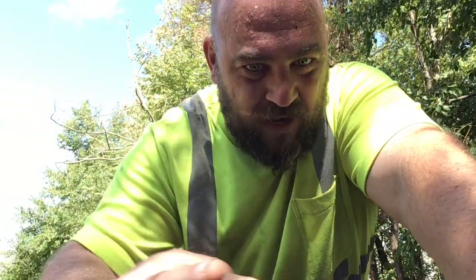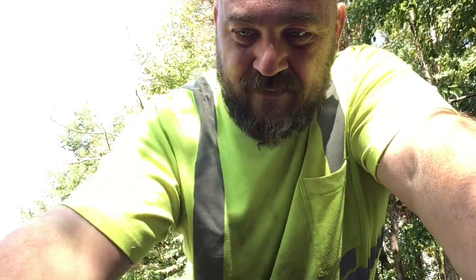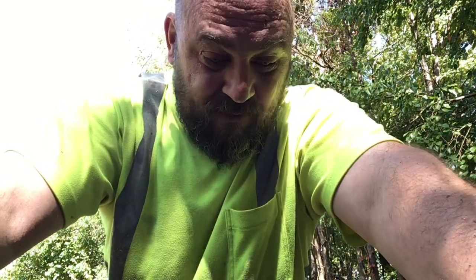So did you see how whenever I lifted the saw up a little bit, it started four-stroking? That's the way I want it. But it wasn't four-stroking in a good cut. Stress that point, a good cut. But boy, does it sound good, doesn't it? It runs good. I definitely prefer it with the governor blocked off. It runs so much better.